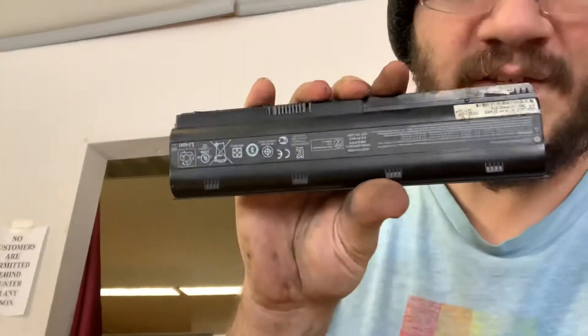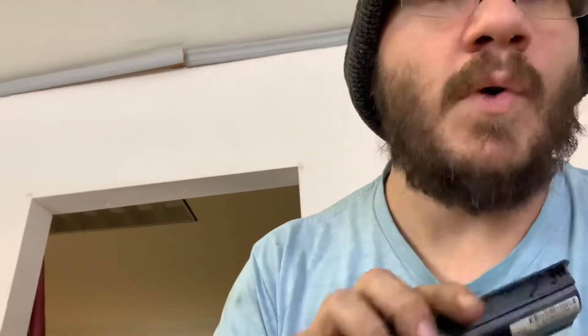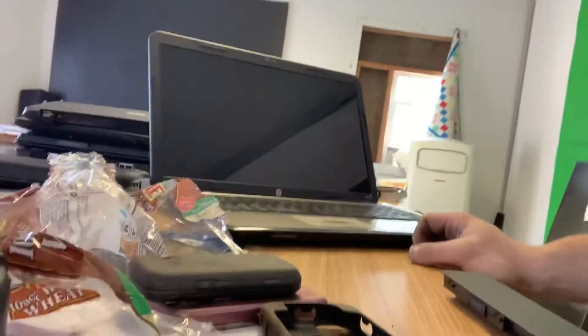So if you are getting stuck at the HP logo screen and refreshing the BIOS is not working for you, I would urge you to first try removing your battery — it should work. Either way, pop on Amazon and get an aftermarket battery for about $12 to $20 shipped free with Amazon Prime, and you'll have it in two days. You should be able to use your computer again the second you take the battery out. That should boot to Windows without a battery. Not a single video on YouTube alluded to that being a fix.